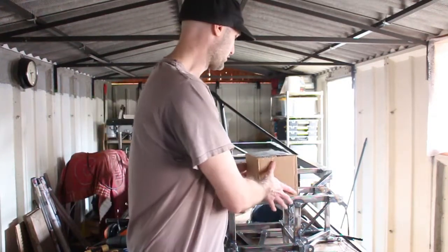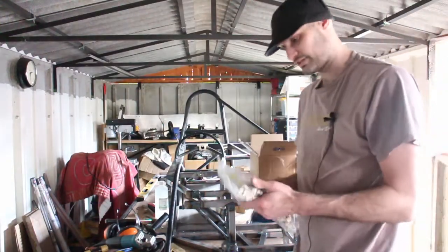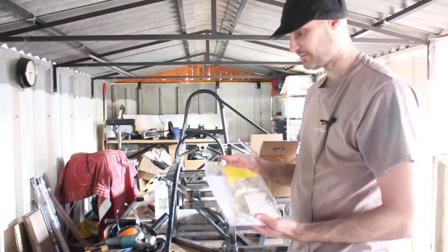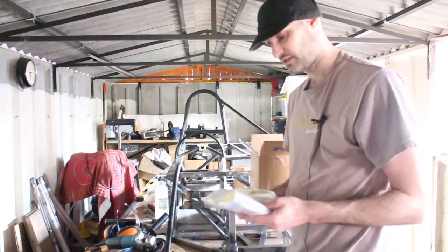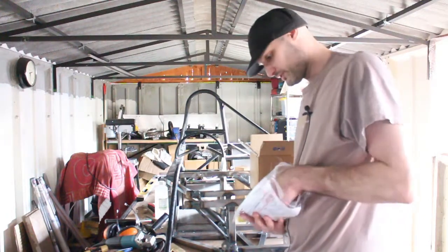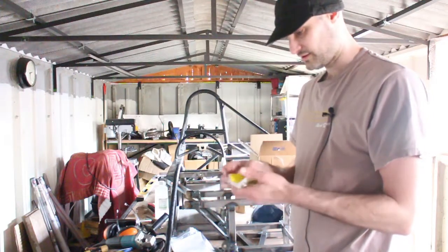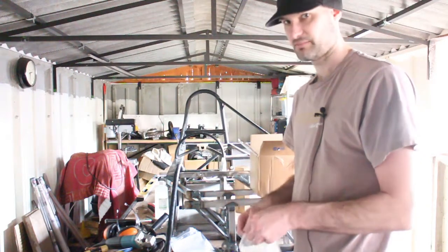My high-quality bolts are here. Because these bolts are used on aircraft and in the aerospace industry, they are high quality and come with batch numbers for traceability purposes. For us that's not so critical — we just need to make sure it looks good visually. Here are the upper wishbone bolts; I've got some slightly longer ones — those are the AN6, so that'll be 3/8.